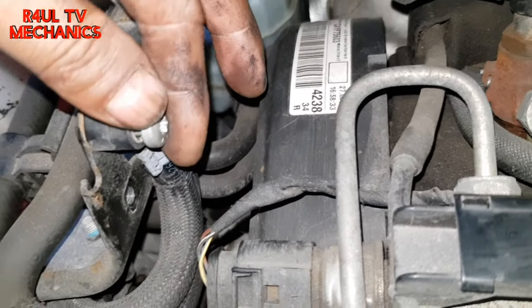We've come into Aldi because we need some degreaser — Mr Muscle or whatever you can buy from your local shop. Before you use the DPF cleaner, get some cleaning product down there, run it through, spray it through. Then put the DPF cleaner through there as well — basically a double clean — and it should be okay. I've done that on the Golf a few months ago: got some degreaser down it, cleaned it up, then put the DPF cleaner through it and regenerated it. It was all right. So hopefully this one should be okay as well.